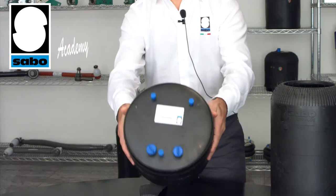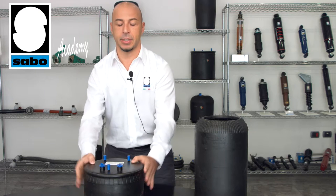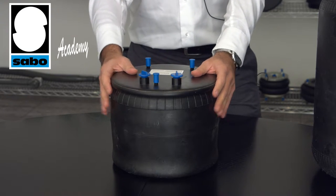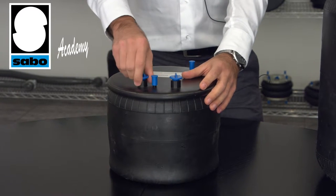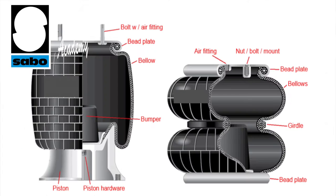Here we see the upper and lower parts in more detail. The fastening parts on specific applications may differ because there are different types of chassis. The air spring mountings, which also include the metal parts, are provided because the truck needs attachment parts. The key concept is that the springs operate using pressurized air and thus require connection to an air pumping system, normally an integral part of the technology of the truck itself.